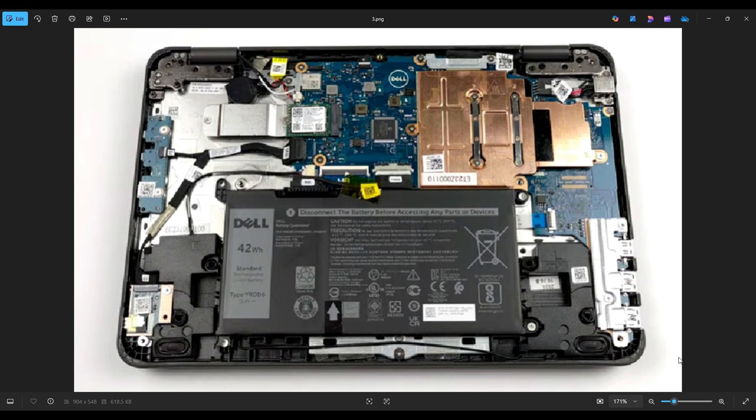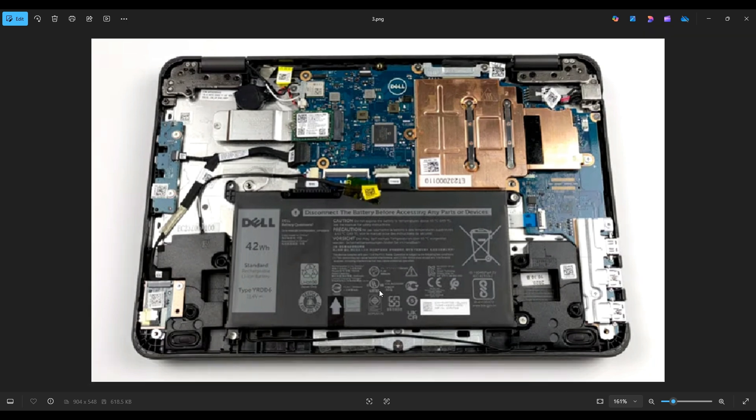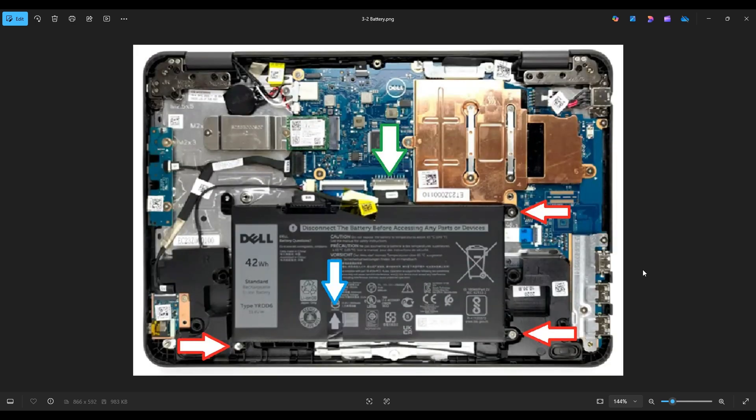Now before I touch anything in a laptop, I always remove or at least unplug the battery. Computers are safest to work on when as little power as possible is running through them. The battery is right here near the bottom of my screen. It's held in by three screws near the red arrows. It plugs into the motherboard here near the green arrow, and there's a piece of black tape near the blue arrow that you have to undo to get that battery out. As far as the plug goes — this goes for any wires or cables in a computer — don't pull on the actual wire if you can help it. Just manipulate the plug. If you pull on wires, sometimes it can damage them or pull the wires right out of the plug. As a grip, on either side of that battery plug, you can use your fingernails or a pry tool to wiggle that right out of that port.